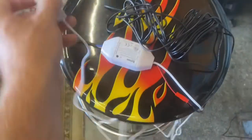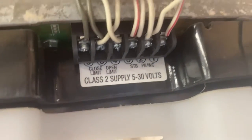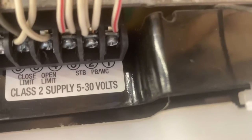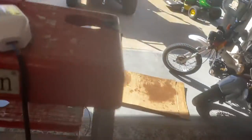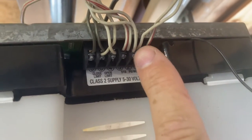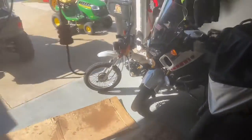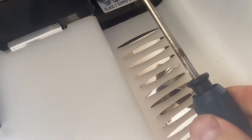To install, first unplug the device, then power down the garage door opener — mine is plugged in right up here so I just unplug it. Looking at the back of my garage door opener on the ladder, you want to find where your push button wire connects — those two wires are what you want. You unscrew those terminals, leave the original wires in there so you can still use your push button, and then add this device's two wires as well. It acts as a kind of Wi-Fi remote push button. We'll unscrew them one at a time with a Phillips screwdriver.